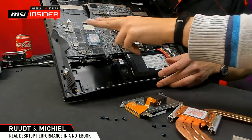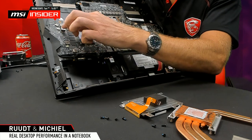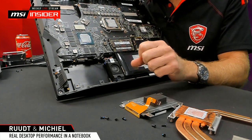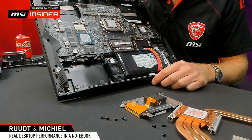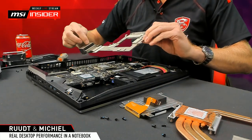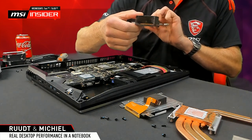Okay, it already looks kind of like a graphics card. You see the memory chips around it. Yeah, exactly. And here are also the chokes. So meaning there's also a power circuit and power stages below these chips. And also here on top, there are 4 power stages. I think this is the main thing. And that's also cooled with a cooling pad on there. It's closer to the end, so it will get rid of the heat through these vents, through this fin stack.